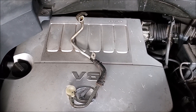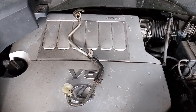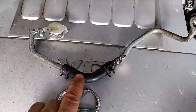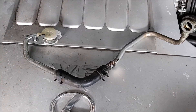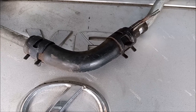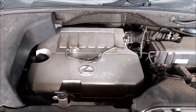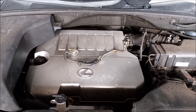Some of the early versions of this engine, 2009 and earlier, suffered from a very serious defect. It's a defect in the variable valve timing oil line that attaches on the engine. On these early engines the VVT oil line has a rubber segment. This rubber segment can wear out over time and burst. This line is under high oil pressure, and if this rubber segment leaks you can lose all of your engine oil very quickly, and if this happens the engine will seize. The preventative fix for this issue is to replace this rubber segment line with an all-metal line.